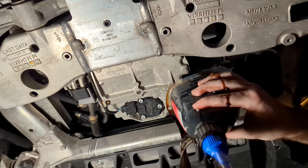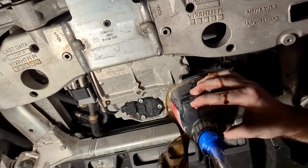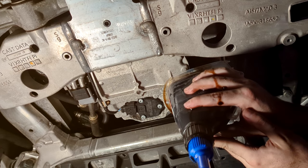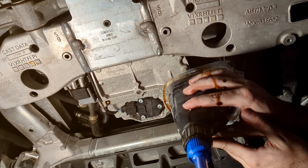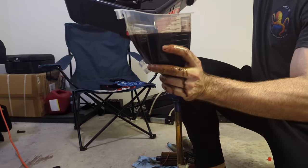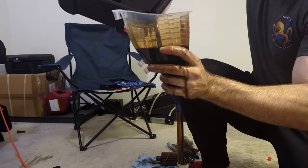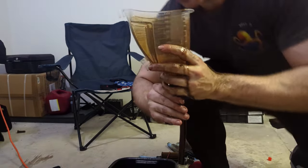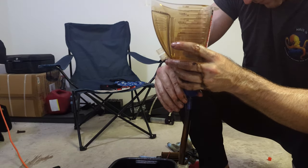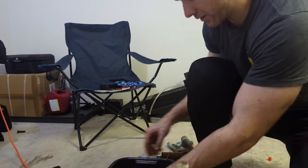Also get a look at the oil color — it really doesn't look like the suggested oil that you're supposed to put in. To be fair, I bought this car used from a non-Jaguar dealer, so maybe they ended up just putting in basic crude oil instead of the recommended one. So let's see exactly how many liters of oil were left in after the extractor. It ended up being about 1.8 liters — almost two liters — which is pretty significant. I guess I'll be changing my oil the regular way from now on.